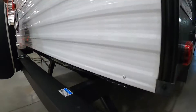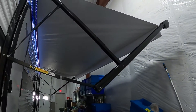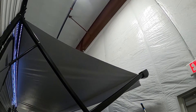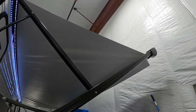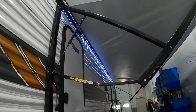Our main low point drains are right there. Rear stabilizing jacks are back here. On your awning, you do have a pitch control — if it's sprinkling and you don't want rainwater to bunch up, pull down on this and it will tilt it all one way. However, awnings are not recommended to be left out in rain or high winds — they're mainly for shade, so keep that in mind.